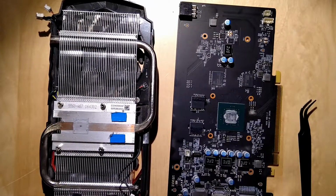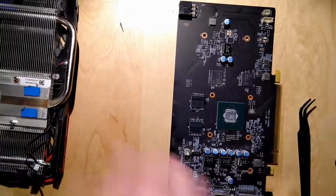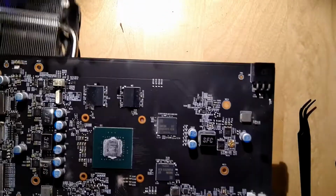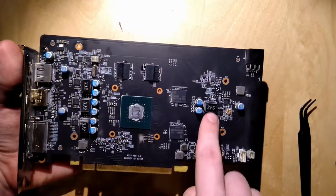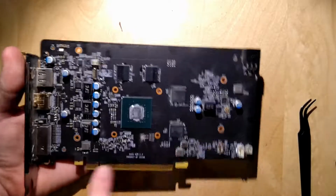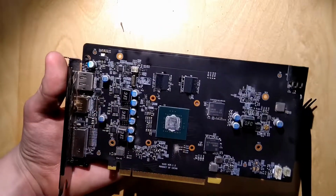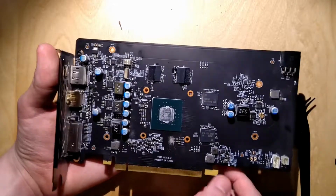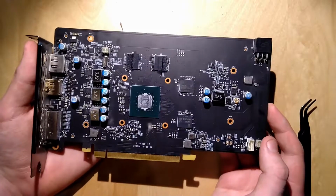Yeah. So basically, I'm gonna take this apart. I already said that this one looks like it's the memory VRM. So we have 1 choke, 2 MOSFETs, and then over here we have a 3-phase for vCore with 1 MOSFET each, and yeah, basically this PCB is really clean. Like, there's not a lot on there.